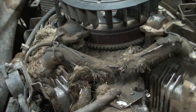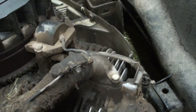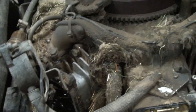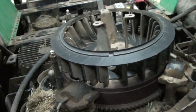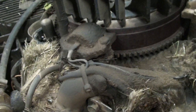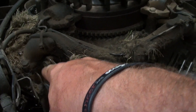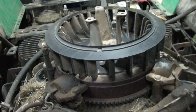With the shroud off, I'm dealing with a pretty big fire hazard here. The cooling fins are blocked off with oily, grassy, dusty junk — that could have been catastrophic any way you look at it. I'm going to get this all cleaned out, then go ahead and get this head off. Take the intake manifold off, pull the head off, and we'll see what's going on.